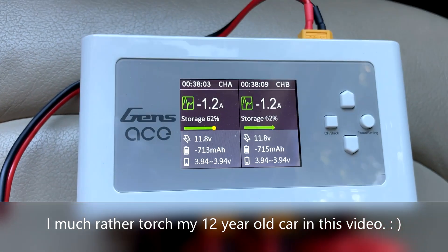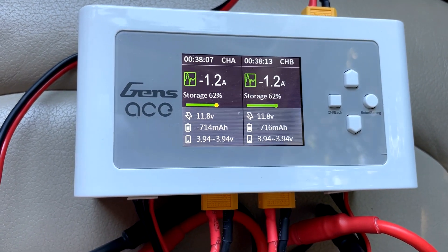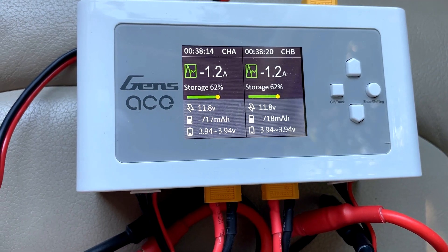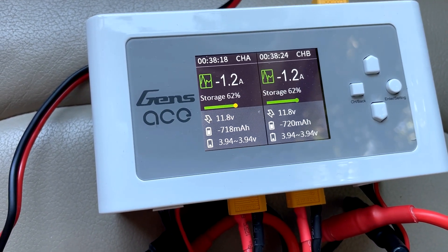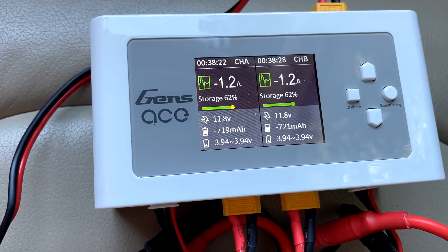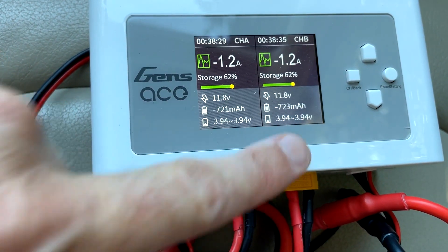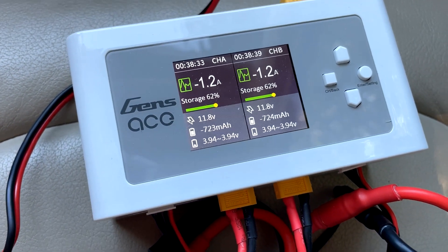I will not have a speedrun video on the Bandit today — it just did not go well. For those interested in Traxxas Bandits, mine is at nearly 100 miles an hour on 3s when I can get it to stay on the road, so check those out. You can see here both of these packs are discharging at about 1.2 amps per hour, so I still have a solid hour more before I get these down to 3.8 volts per cell, which is where I keep them for storage voltage.